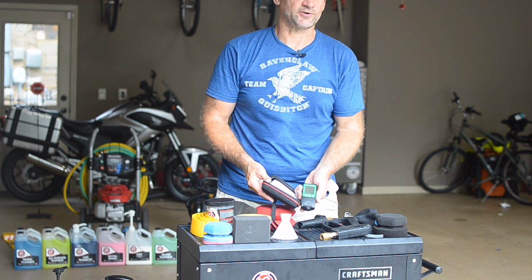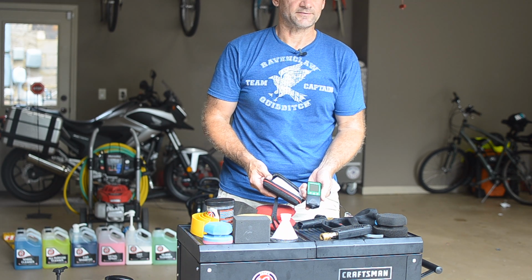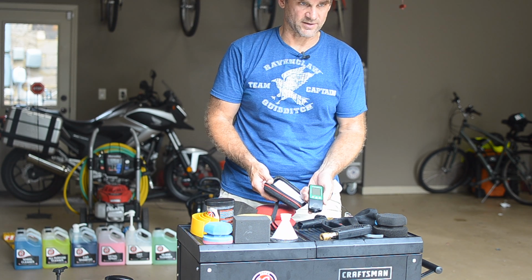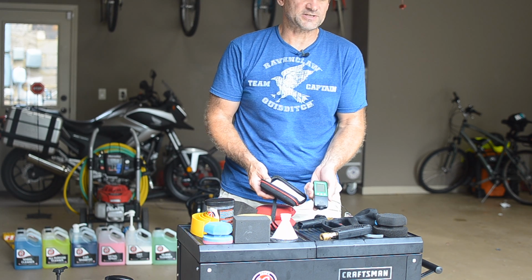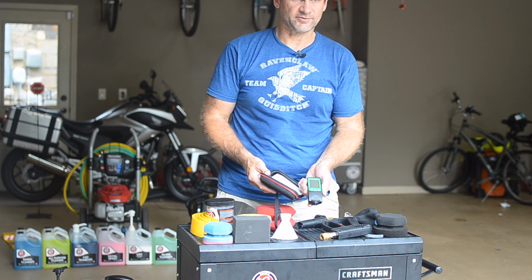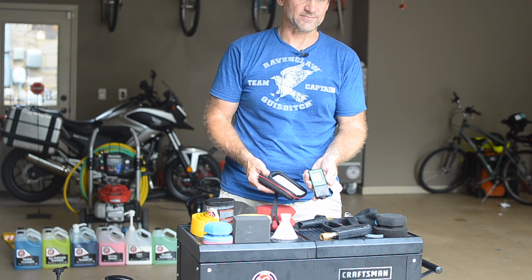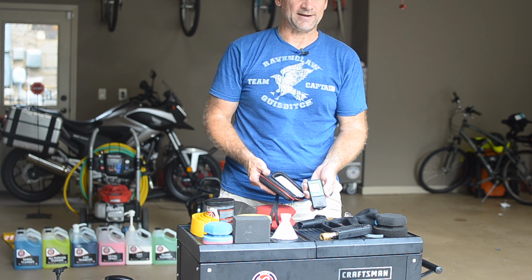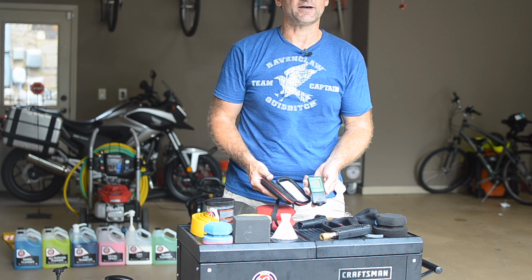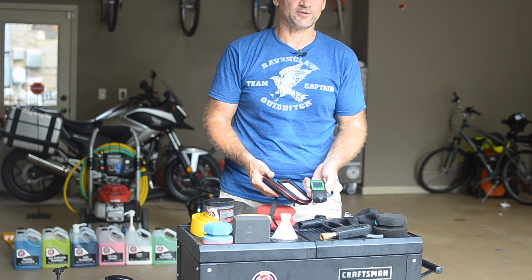As long as the paint's sort of in the 4 or 5 range in terms of the total thickness, that's the primer, the paint, and the clear coat. That's all this measures. That's all it's smart enough to measure. You really get a feel. What this tool's really told me is, after polishing a car with all the stages I've shown you, not including the compound, it really has no effect pre and post, at least for the accuracy of this meter, on the thickness of the paint. My Camry videos that you saw, I looked at this before and after. You'd think I took a ton of the clear coat off, but based on this meter, just did a little bit, not enough to really be concerned about.